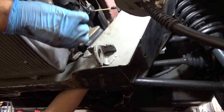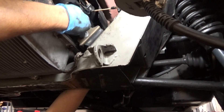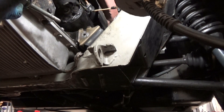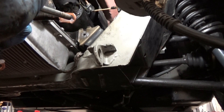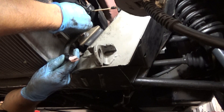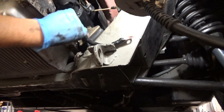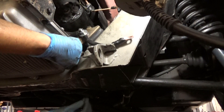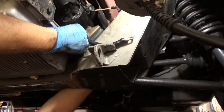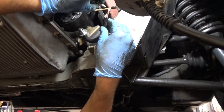What we're going to do with this one is run it and attach it to the back. That way we preserve the original ground connection but fortify it with a better connection — more protected, thicker gauge wire. Go ahead and run our connection through there, insert it, and make sure we don't get any dielectric grease on the threads because when we torque this down it has to be to factory specifications. Relocate it through this little opening right here, feed it through, and pick it up on the other side, then run the bolt.